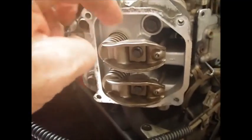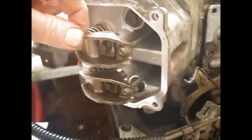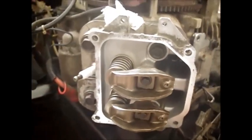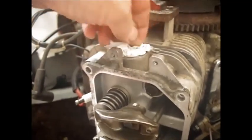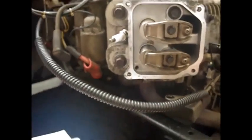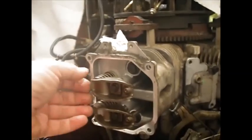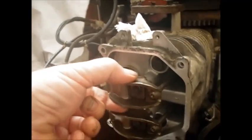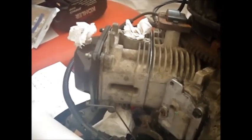I'm going to look and see if I can find a torque setting for the rocker arms - I don't see one anywhere, so I'll look online. Since that's just a shoulder bolt, it can't be too much. I also cleaned off where the manifold's going to sit up here. I've got to put the shrouding back on this side and remount the starter. I found that the rocker arm torque is supposed to be eleven foot-pounds, so I'll torque both of these at the same time.